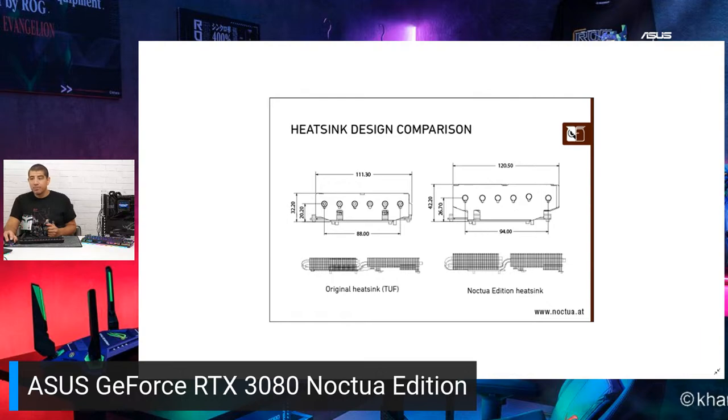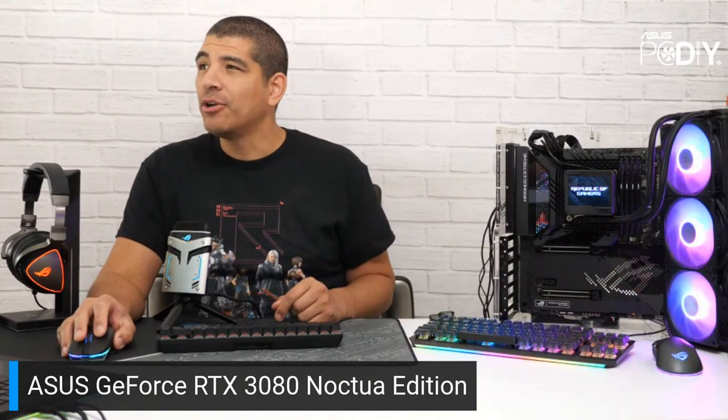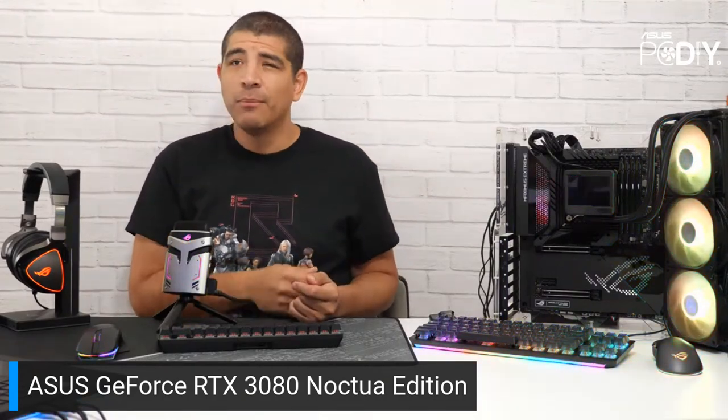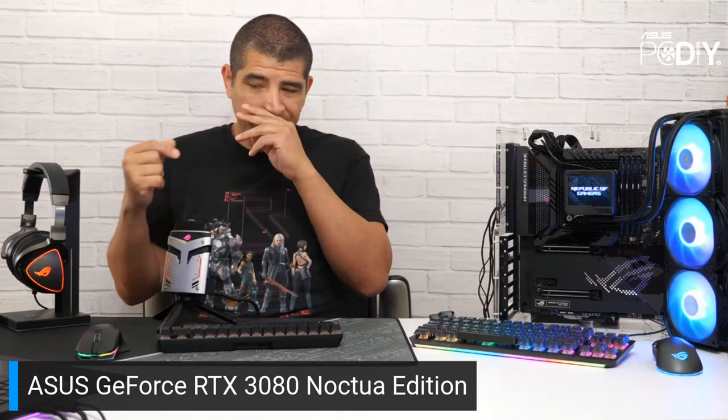I will also note some people do ask, can you swap the fans? These are really pretty much just about the best fans you can get. I don't know why you would necessarily want to swap them. There is adhesive material that we actually use for the fans to bond them to the actual internal shroud and frame. So you do have to be cautious that if you were to open it, there's only about four screws to essentially remove the shroud frame from the body. So if you did want to access it and swap out the fans, technically this is possible, but you would also want to be careful of that adhesive material. And then you would still need to remove the adhesive material, put that on the new fan, swap the fans out, and then make that change. Okay. So it's not necessarily ideal, but technically I suppose that it would be possible, right?